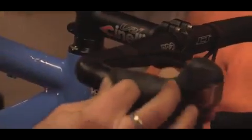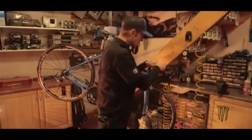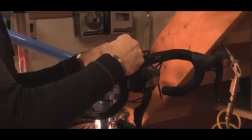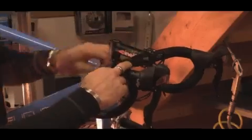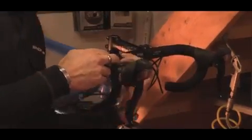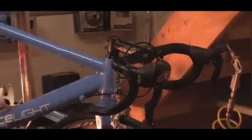Now it's normally PVC taped to the handlebar, underneath the handlebar tape. Obviously that's already removed at this stage. Peel the lever hood back, take a decent blade, and just cut carefully through the PVC tape. Obviously you want to try not to score the handlebars, especially if it's a carbon set. Take the tape out of the way, you'll find everything springs to life.